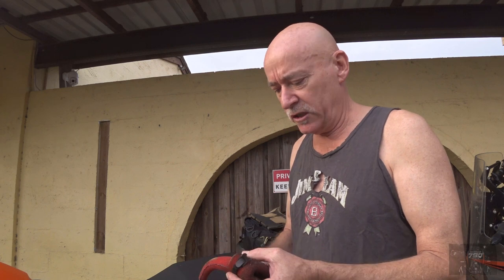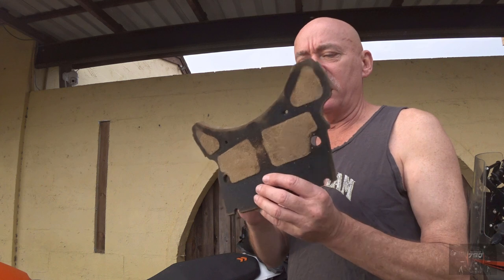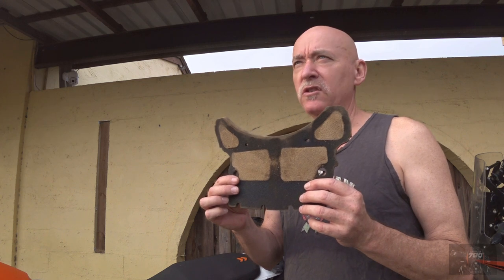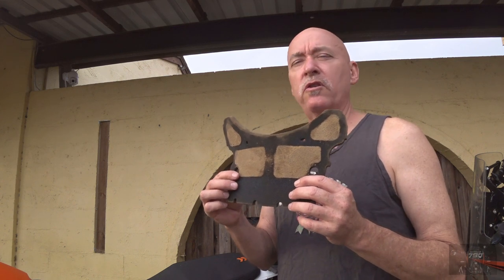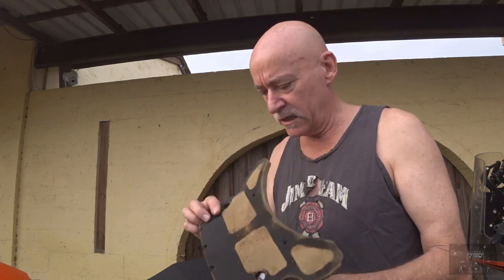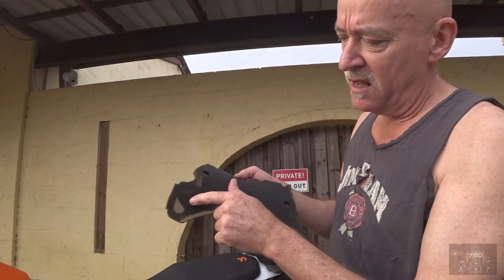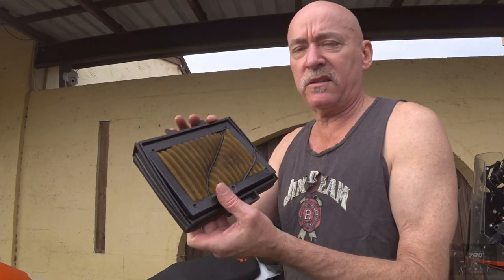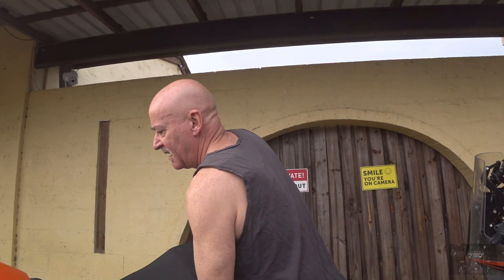The next evolution was the power plate from Rottweiler. I had it on for a four-day ride — 2,200 kilometres, probably two-thirds dirt roads, one-third sealed. It did have some dirt coming through in the main areas, and you can see the dirt on the insides. That's the filter element from that ride on the 890 Rally.